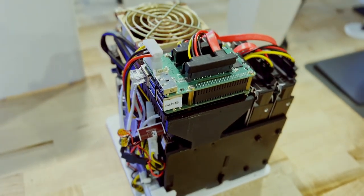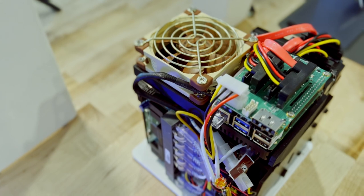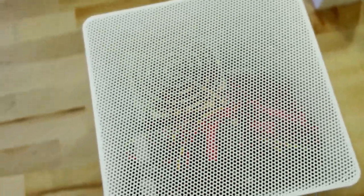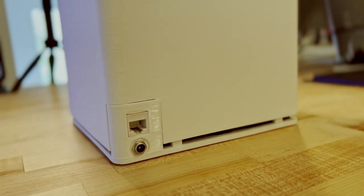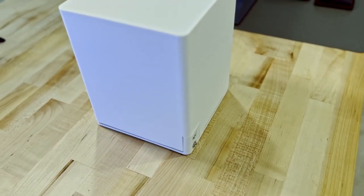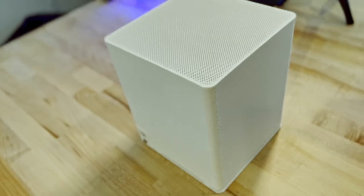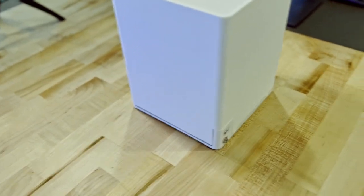That allows us to use just a single fan to cool the entire unit — it's nice and quiet with plenty of airflow, and keeps everything cool and happy. You might ask: why am I blowing air downward when heat rises? Well, the air is coming in through the top — I made this fine mesh pattern for the air intake to keep any insects out — and then the ventilation at the bottom is where all the air exits, all the way around the base. Just a couple of millimeters of clearance, but that's plenty of surface area. With air blowing out, insects cannot wander in. You might think that's a little overkill, but no matter where you live in the world you have insects around, and the last thing you want is to open this up and find that an insect has made its home inside your server. With air flowing out the bottom, nothing is crawling in, and the fine mesh on top means nothing is getting in through there either.